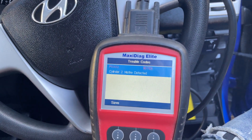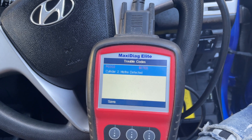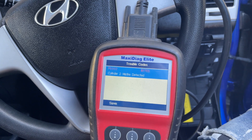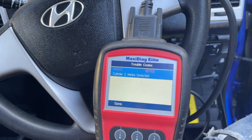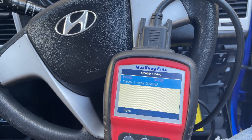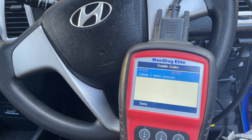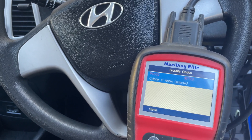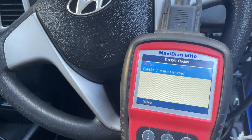It even tells you which cylinder is failing. We're going to be looking for a problem with coil, plugs or lead especially on that second cylinder. We'll recheck the plug gaps and make sure the plugs don't need replacing. That's why the engine light comes on - it's running on three cylinders or two cylinders. Every now and then it will come right again, and then the engine light will come back on and it will misfire again. So we'll jump under the bonnet and find the problem.